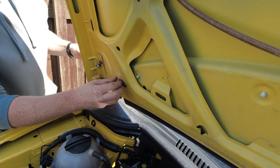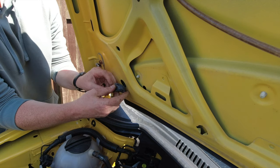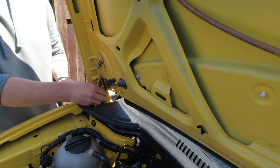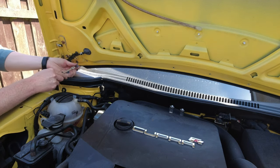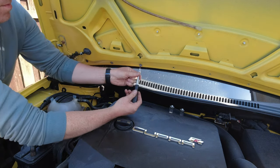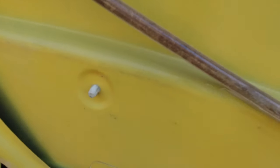Under the bonnet, pull the washer hose back through with the grommet and put the grommet in place around the edge of the bonnet. Then clip together the white plastic piece and the black tab on top of the hose. Then reapply the 10 bolts along the bottom to re-secure the plastic panel. If any excess silicone has come through with the clips, just wipe it off from under the bonnet.